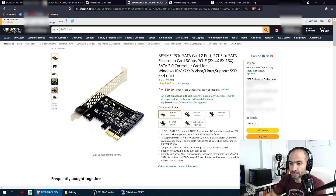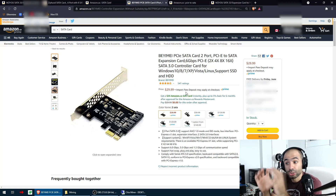What I'm thinking of doing is getting this 'PCIe to SATA 6G Expansion Card' — it's a dual-slot card, giving you two SATA ports per card in a single PCIe slot, for about $30. I might pay a little import fee but I'm thinking of getting two of these for $60, which gives me four slots and lets me add four additional hard drives to my Chia plotter/miner.